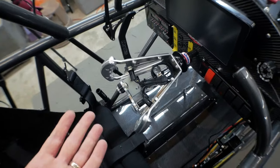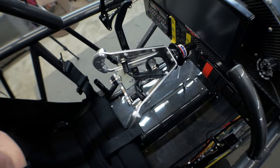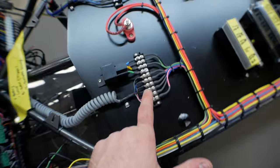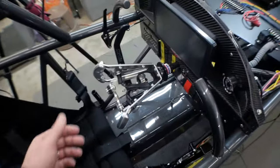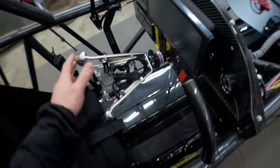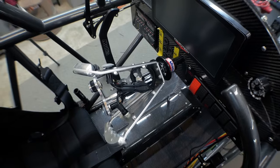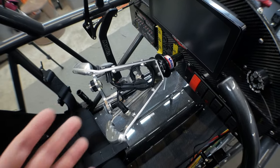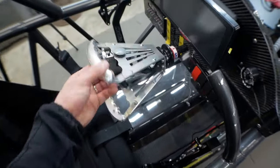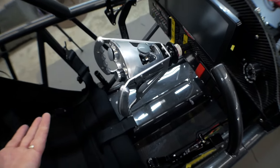That's not going to be easy to do at the racetrack to replace a button, but if I'm at the racetrack I'll just pop that button out, cut it out of there, put a new button in, and run an additional curly cord all the way back to these terminals and hook them up in the appropriate spot. That's the plan if we're in a thrash situation between rounds. As you can probably notice, this threaded connection is not as fast as something that's a quick connect — it's not as fast as a Deutsch connector, I get that. But what it is is a very strong connection, a very reliable connection, with a lot of great strain relief. And honestly, I don't plan on taking this steering wheel off all that often — I'm not the kind of guy that takes the steering wheel off just to get in and out of the car.